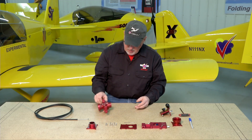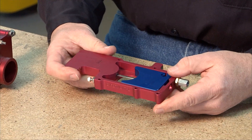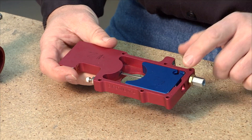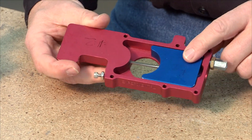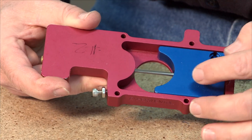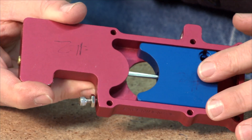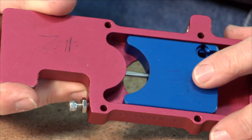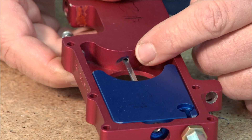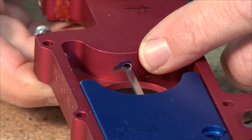Just a few parts make up the throttle body. We'll start with the throttle body itself — the main body of the Aero Injector. This is the throttle slide right here. Notice as it slides back and forth, it opens and closes the air orifice — throttle closed, throttle open. You'll also notice that as it moves, it is carrying this needle with it. So as the throttle closes, it slides the needle in; as the throttle opens, it slides the needle out. That needle is tapered, and the taper acts in this fuel orifice here to meter the amount of fuel being injected into the air stream.